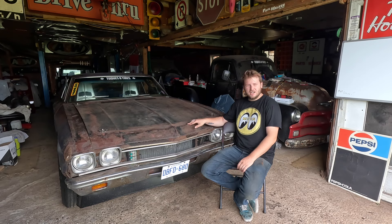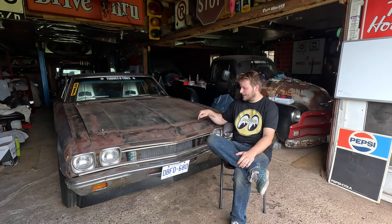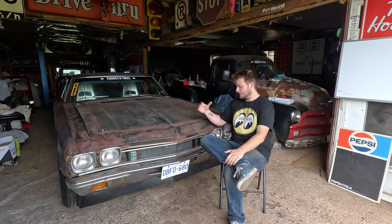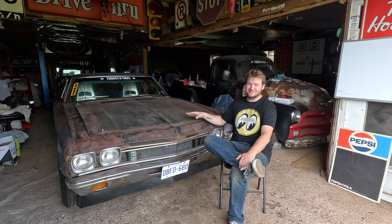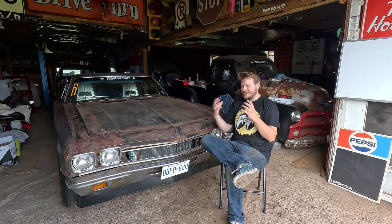Basically when we left here, we tried to leave at 4:30 in the morning. We didn't make it too far — literally about 20 minutes down the road we had to turn around because my clutch line blew. In this thing I put a hydraulic release bearing. I originally thought it had overextended because I had one before in another project that actually overextended when the clutch pedal was pushing the hydraulic release bearing too far. When I lost the pedal, I thought that's what happened. I was pretty bummed because we did all this work to get the car ready for Power Tour — me and dad busted our ass on this thing since Motorama — and I was worried something was going to not let us go.